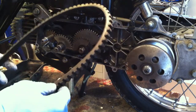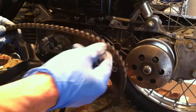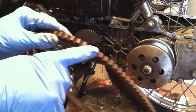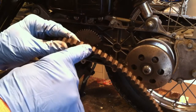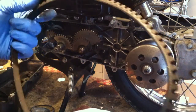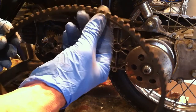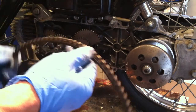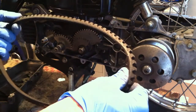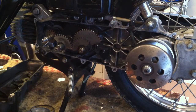What I've discovered with this stock belt is if you just invert it, you'll get the fat side rubbing on the pulleys instead of the thin side. You don't need these teeth or cogs in the belt because they don't even touch the pulleys given the angle. So you can keep the same size belt, which is nice for acceleration. The wider side is going to ride up higher on the front pulley, giving you more speed — and you don't suffer from the laggy slow takeoff of the BX31 longer belt, which takes a while to spin up and tighten on the pulleys.